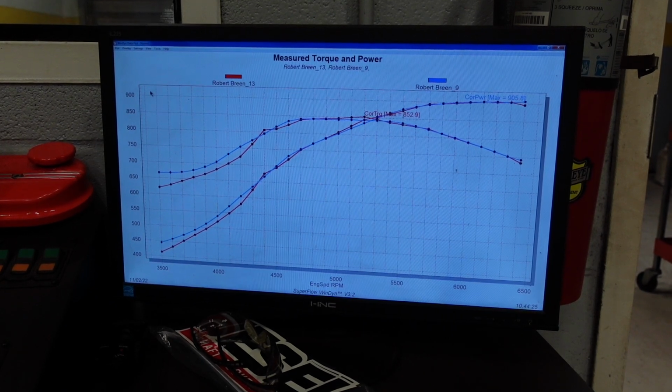Super, super cool. Coming up in the future, we do have that 1,000 horsepower 632 lurking in the room. It's gonna be the next level up. It's getting a completely redesigned cylinder head. It's gonna be 13-to-1 compression running race fuel, and that motor should easily make the 1,000 horsepower number now that I've seen how much this motor made, 11-to-1 with a conventional big block head.